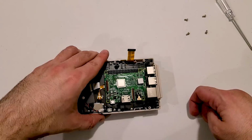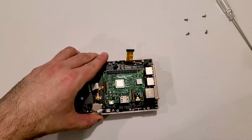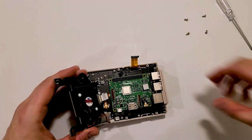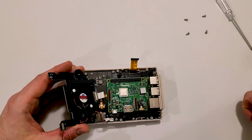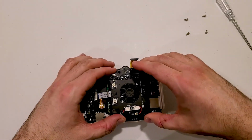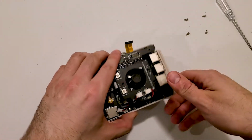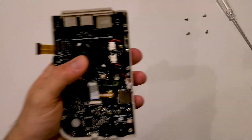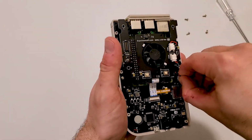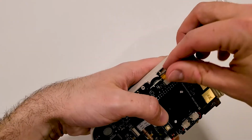Okay. One thing I did not realize that you saw a minute ago, that I had a heatsink on top of the CPU that will not fit with the fan module, so you'll have to pop that off. Now we can connect the fan module. Make sure you line up the I/O pins there and just kind of carefully press down. Once that's good, we'll connect the fan connector again. We'll reconnect the ribbon cable on the side.